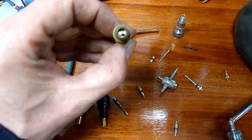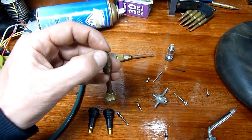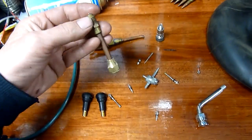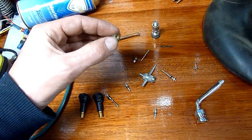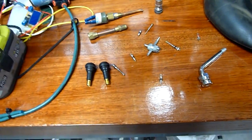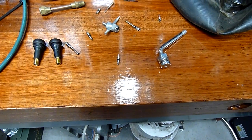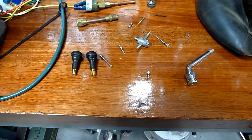Refrigeration is exactly the same — you push the pin in and gas comes out, or you put a sealed chuck against it and push gas in. As soon as you pull it off, the valve checks the flow. It's a poppet style check valve, very simple and very effective. I'll get the camera a bit closer and take a couple of these apart so you can see.